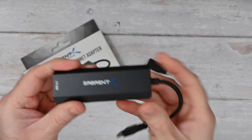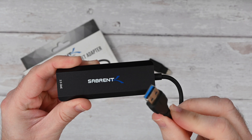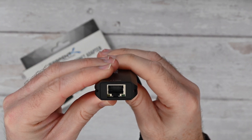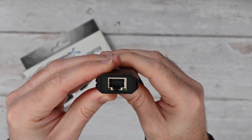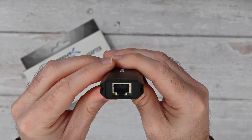It's a metal enclosure, so this connects to your computer via either USB-A or USB-C. On this end here we have got an Ethernet socket and this supports speeds of up to 2.5 gigabits — really very, very good indeed. There are two little activity LEDs built into that connector as well.